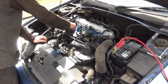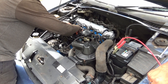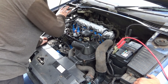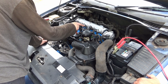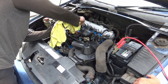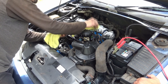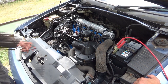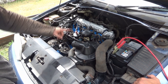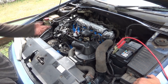Now I'm going to put the glow plugs in. Glow plugs are in — I need to put this link wire into the glow plugs so all glow plugs will have equal amounts of power. The fuel system is fully bled with fuel going through every single cylinder. The glow plugs are now installed and secured, and the link wire bridges all four together. I've put the main feed on cylinder three's glow plug — it doesn't matter which one since the link wire connects all four equally. I just found it easier to connect there.